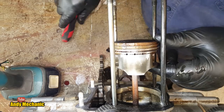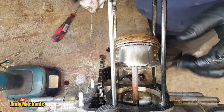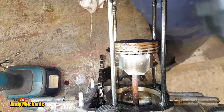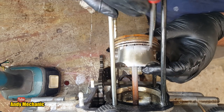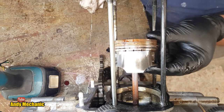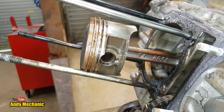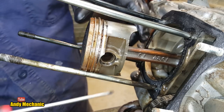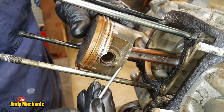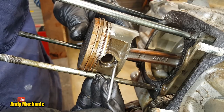You'd expect that. Okay, well, we can pop the piston off. And to do that, we've got to take out a little clip. You've got the piston pin, or the gudgeon pin, inside that links the piston to the conrod. And at either end, there's little tiny clips. Now, maybe this screwdriver is just small enough. Now, I may not have left myself enough room to get the screwdriver in and the camera. But you can see, just in here, there's a little tiny circlip.